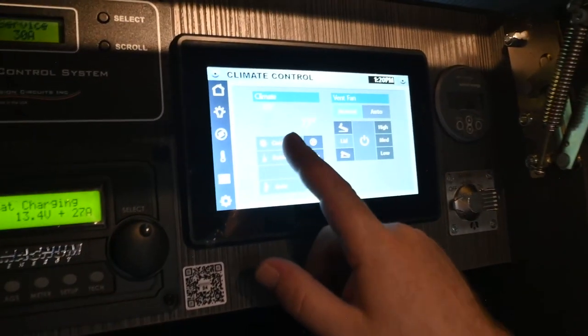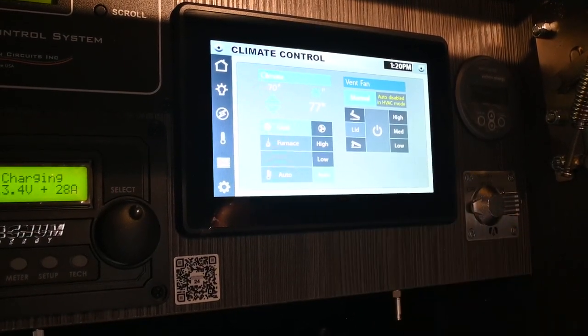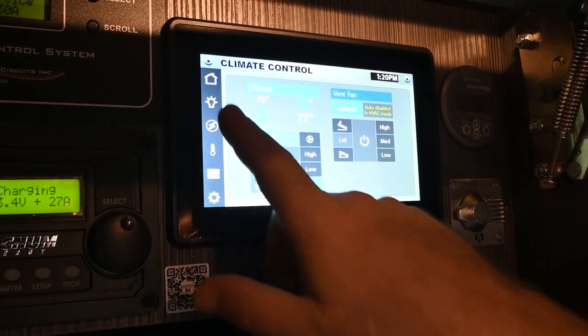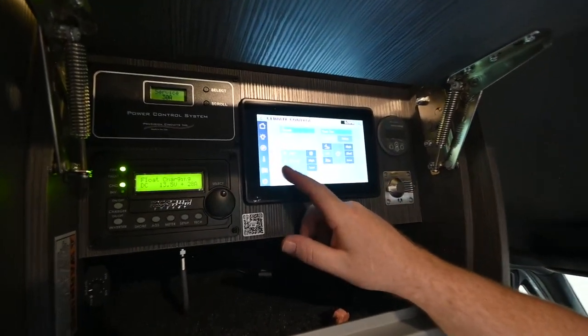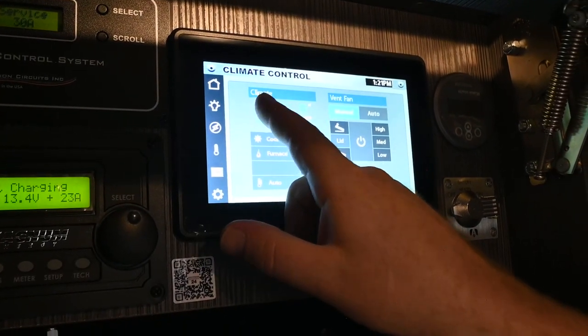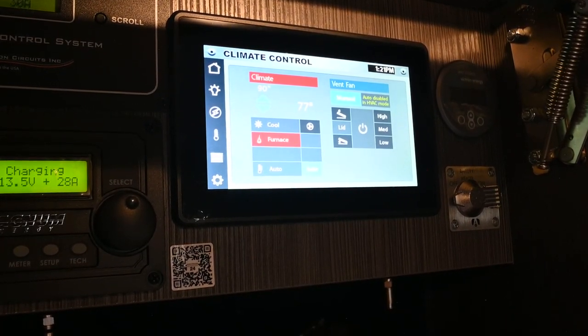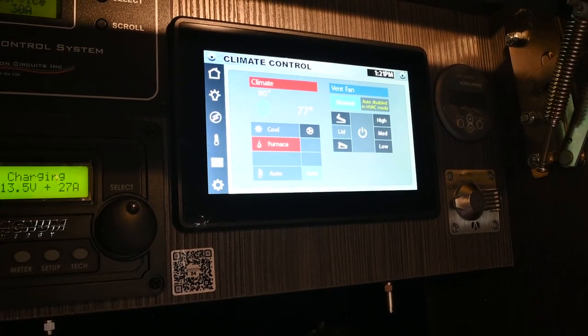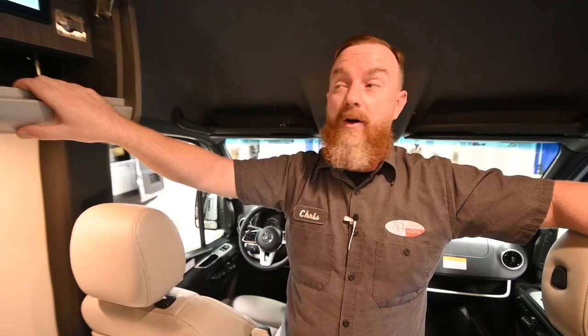After that, we've got the HVAC. We're going to turn the air conditioner on — notice when we do that, the overhead vent fan is disabled. There's your little snowflake icon visible on the home screen as well. When you go to switch from the air conditioner to the furnace, turn it off here, turn the target temperature up over ambient, and then turn the furnace on. That'll help the furnace kick in a little faster, but the air conditioner doesn't shut off immediately — it can take up to seven or eight minutes for the furnace to finally kick on.